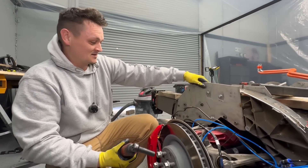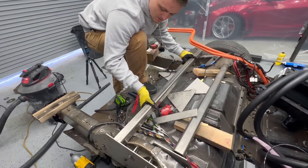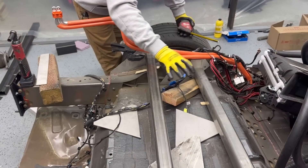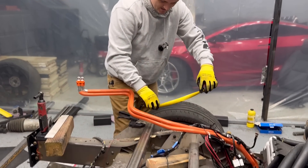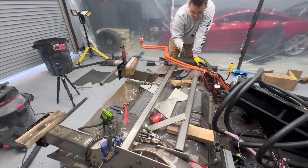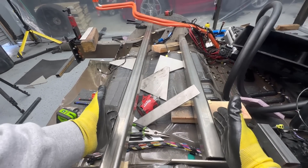That's a lot of bolts — just for this side. This one gets four. On to the next stage. These two beams are stainless steel, quarter inch thick — a little overkill but that's all I could find in my general area. These beams are going to be centered to where the strut connects. If you look at the knuckle right here, this is where the strut connects — and these are centered 12 inches apart from the outer edge.